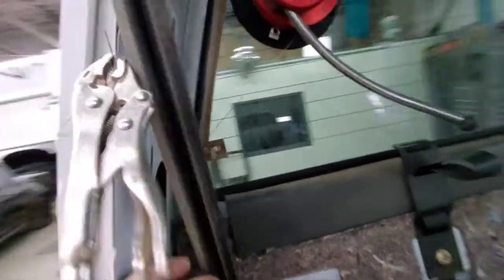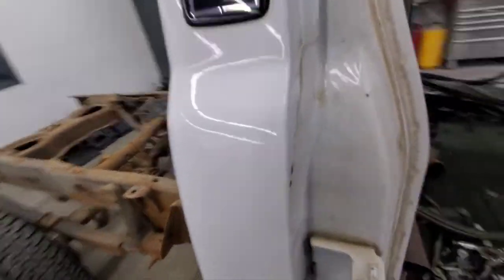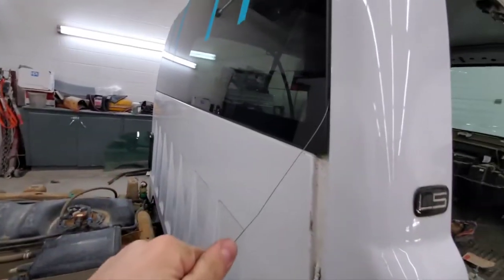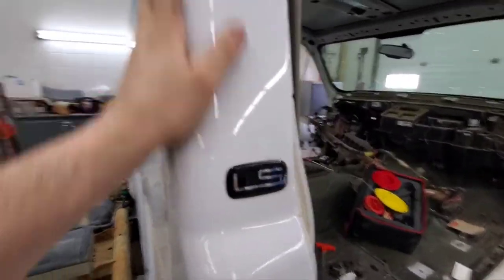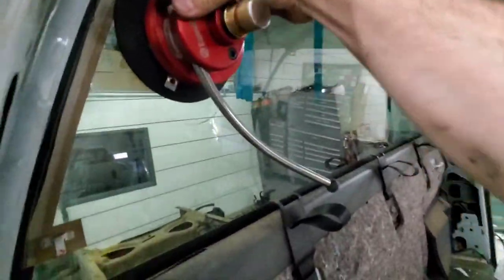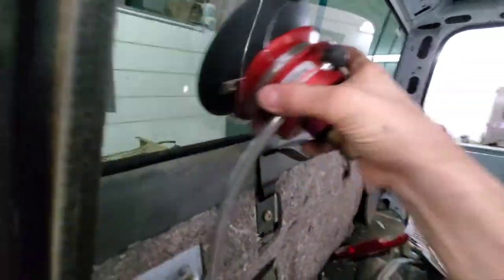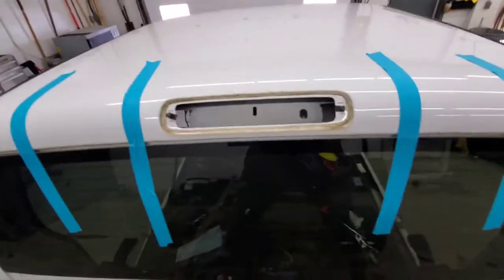Right at the end, you get it around — you don't need this here anymore. Put some tape or something to protect the paint. This truck is not a customer vehicle, it's my own, so I don't really care about it. Gently set the tool down. The glass is holding on by that tape right there, so I'll pop that guy out right now. Quick demo — glass is out.